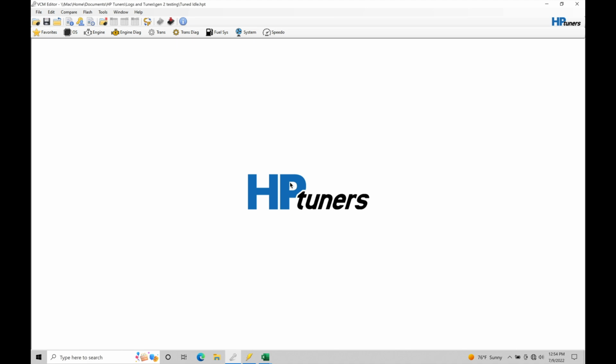So what we need to do is jump in and understand the couple key areas we need to pay attention to for cold starting and warm-up conditions. I have a data log that we're going to be pairing to this tutorial that you can open up and follow along with in the VCM Scanner. The file I'm working with is my tuned idle file. We had our idle tutorial going through all the various aspects of the idle control and the torque-based logic in the idle control. I lowered down the startup targets in terms of the RPM.